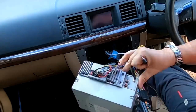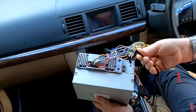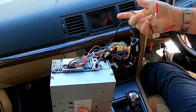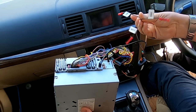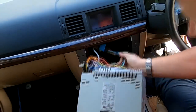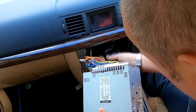On the back of this radio there's a little remote socket and it says REM on it — all we've got to do is plug our three and a half mil jack into there. We don't need the extra three cables — that's if you've got a radio without a jack point. So then we've got to push all this back in. This is probably the most difficult part of the operation — getting all the cables in so you don't bulk the radio system down and it doesn't stick out too far.